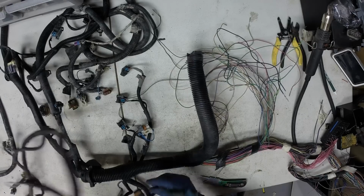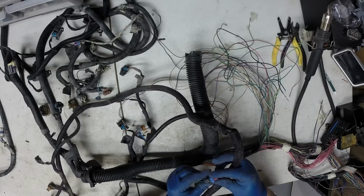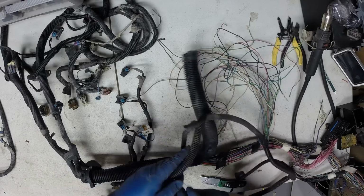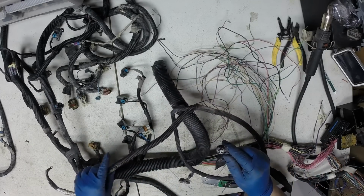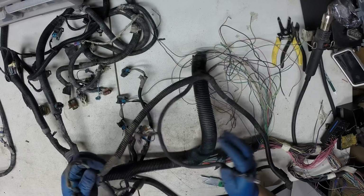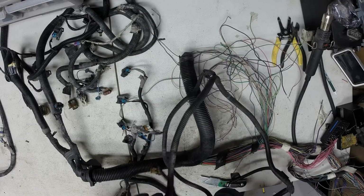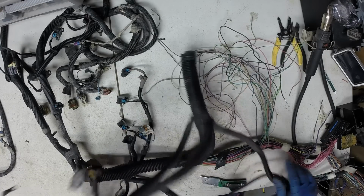And then continuing on that branch, it runs to the coolant temp sensor. We got a damaged connector there. We'll replace that. The ground of the engine block. AC compressor. This is AC high side pressure sensor. Oil level, crank sensor, and starter solenoid. And we'll completely unwrap this and put new loom on it. We'll be removing the oil pressure, AC compressor, AC pressure sensor.